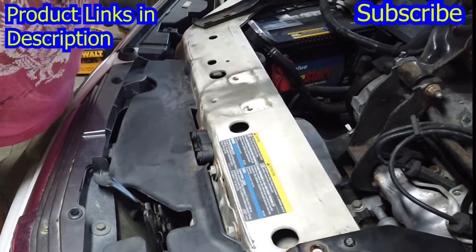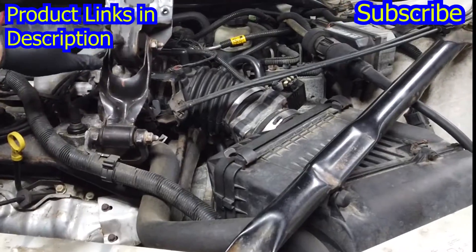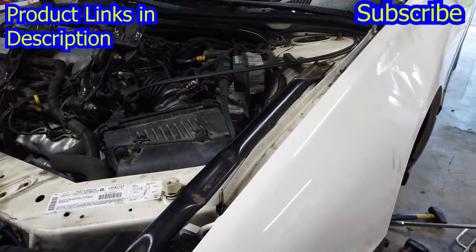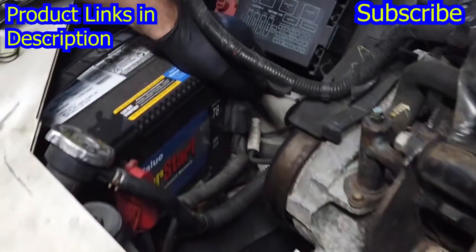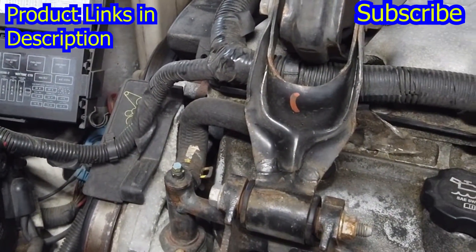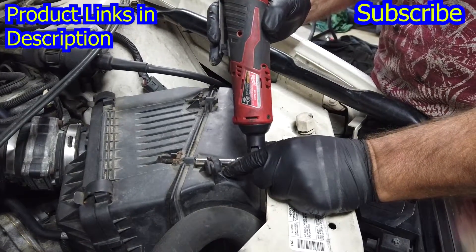Here's how we do it — we're just gonna pick it up and set them out of the way. We're gonna go ahead, because we are messing with the radiator fan, get a number eight and go ahead and pull your battery cable off, just to keep the old barbecue from happening. So we're gonna go ahead and take these number eights off right here — there's two of them.